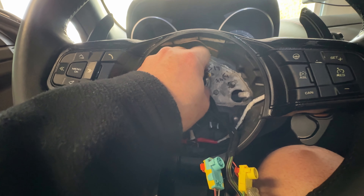Just attached the steering wheel back, put the center bolt, and I'm ready to reattach the connectors to the airbag. The airbag should just snap back in. Then lastly I'm gonna remove the tape covering the R emblem, put the carbon fiber cover on the trim area, and then it's a matter of connecting back the battery and checking that everything is working appropriately. Let's do that now.